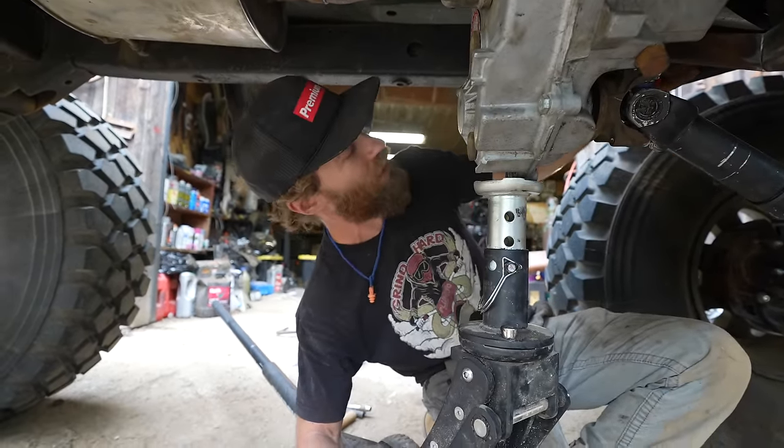Got this here in the lathe. I'm gonna use the lathe to take the weld off, and then I'll leave this end chucked in here and it'll stay straight. And of course this end is centered on the live center, so it should stay reasonably straight. When I put it back together, I can just squish it in there and re-weld it in the lathe, and we should be good.